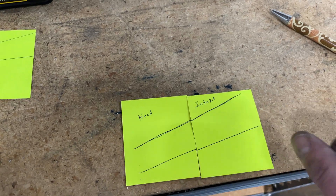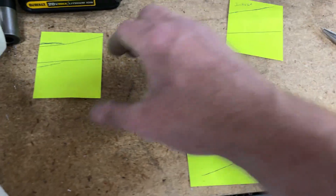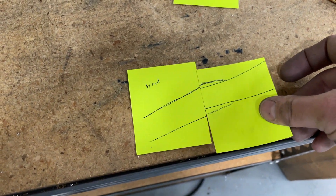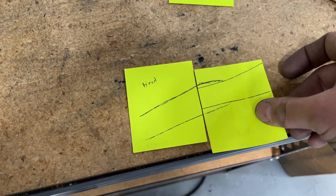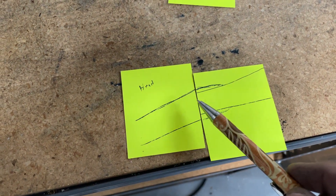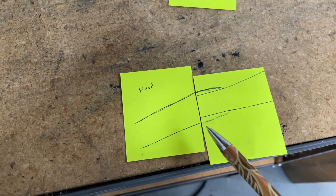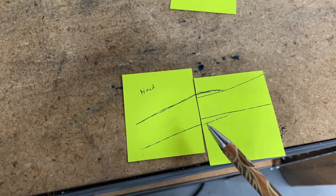This means you've got the head, it looks like it lines up, it's one continuous runner, everything looks good. The problem is most intakes don't come that way. Usually they're smaller than the opening anyway and then you've got a port match. So a lot of people will just port match like through here and through here and it gets you pretty close.